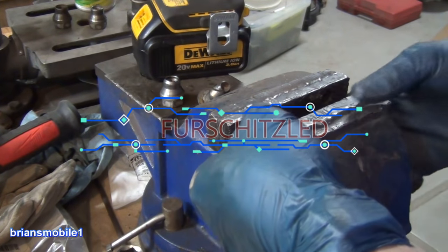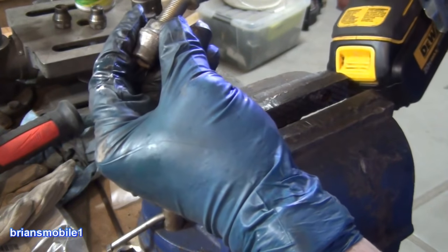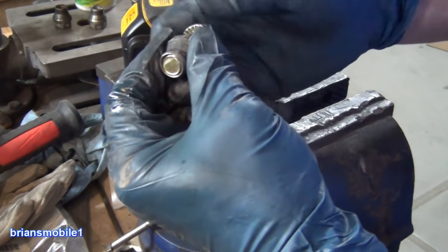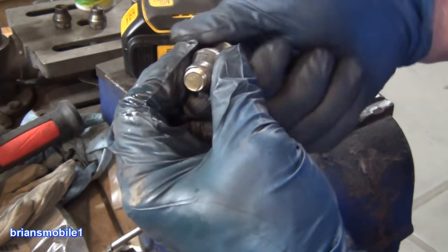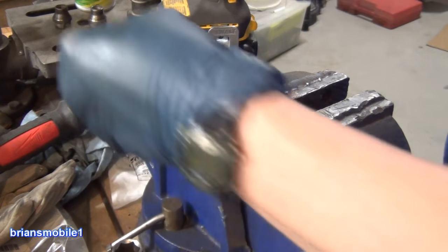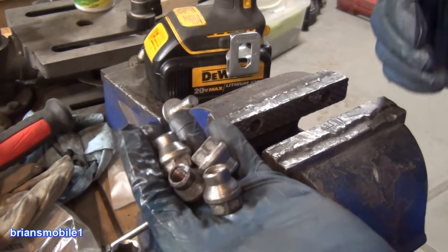Alright, this one was pretty rough. Let me get down close — that's why we're doing this, trying to save time. It's a little chewy at the bottom, just a little bit, but you can still get it to go in by hand. These are not going to chew up the wheel stud anymore. Done. Time to spray out the lubricant and put them together.